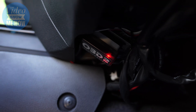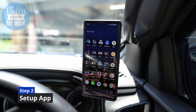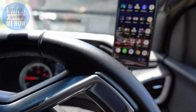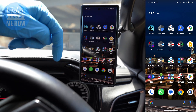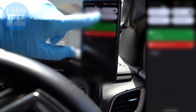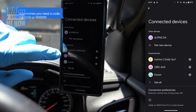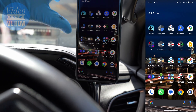From here it's a matter of starting to set up our software. Once you've got your phone ready and your module plugged in, start your vehicle — partly because it's very hot outside, but also because we want the phone talking to our sensor. With the car started it's already reading data and pinging for a signal. You want to connect your phone to the reader, almost always via Bluetooth, just like connecting any other device. We've already got our OBD Aus connected. Once connected, you then need to get some reader apps.